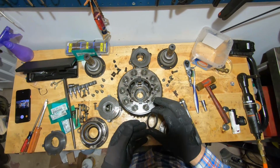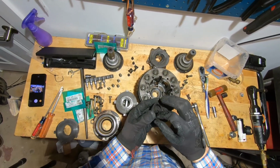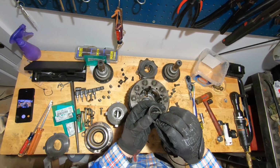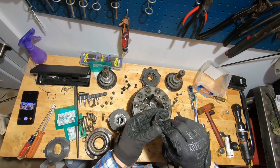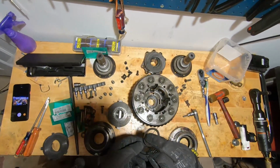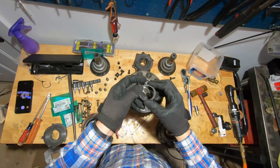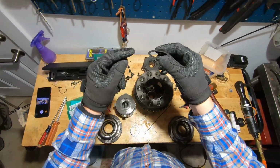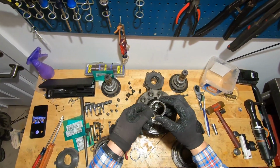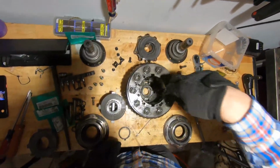So I wanted to go over the whole stack from bottom to top. And so this is how it goes. You've got this little guy, flat spacer. That's the very bottom, right? So we get that, throw that guy in there. The next is one of these concave spacers. Remember, the concavity goes to the inside. So we get that guy down in there.